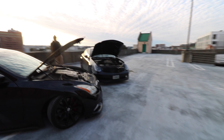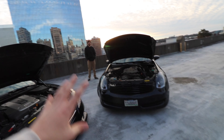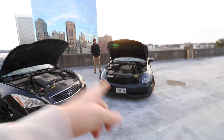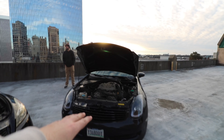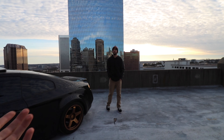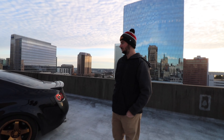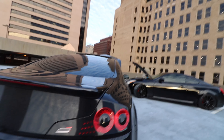That's pretty much it for this comparison. We're not going to race the cars because, speaking facts, the G37 will beat the G35 stock for stock — the G35 has the rev up DE and the G37 has the VHR. The G35 coupes never came with the HR unless you had the sedan. Also, the 03 and 04 G35s came with an older transmission known for grinding gears — the synchros go bad in them. The 03 to 04 also has different brakes and the wing is different — it comes all the way over and hangs off the side, whereas this one just stops right there.